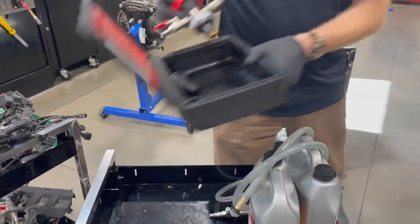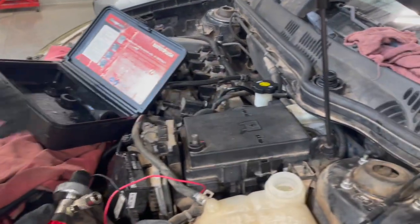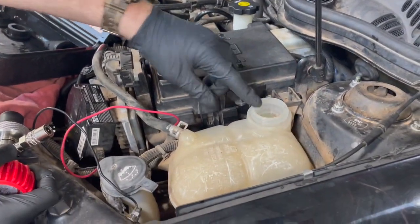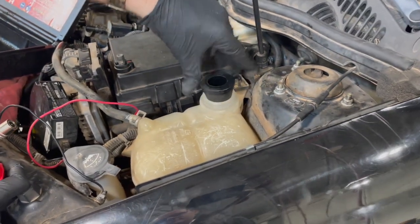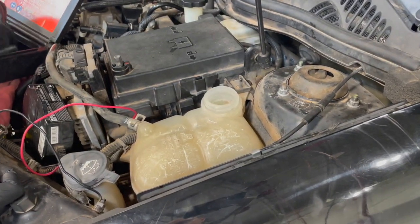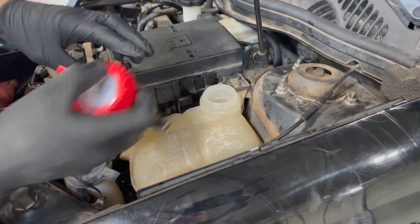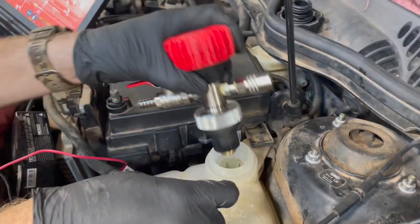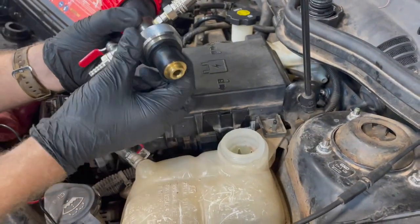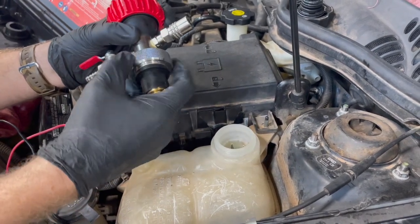The big portion is we need to find a way to attach this to our filler neck — so either the radiator or cooling bottle, whatever it might be on the particular car. A common scenario is to use that cone, sometimes some of these adapters. On this particular one, we're going to use just the fitting itself. This is rubber here to make the seal. It drops in, and when we turn this, it's going to increase that diameter to where we have a nice tight seal.